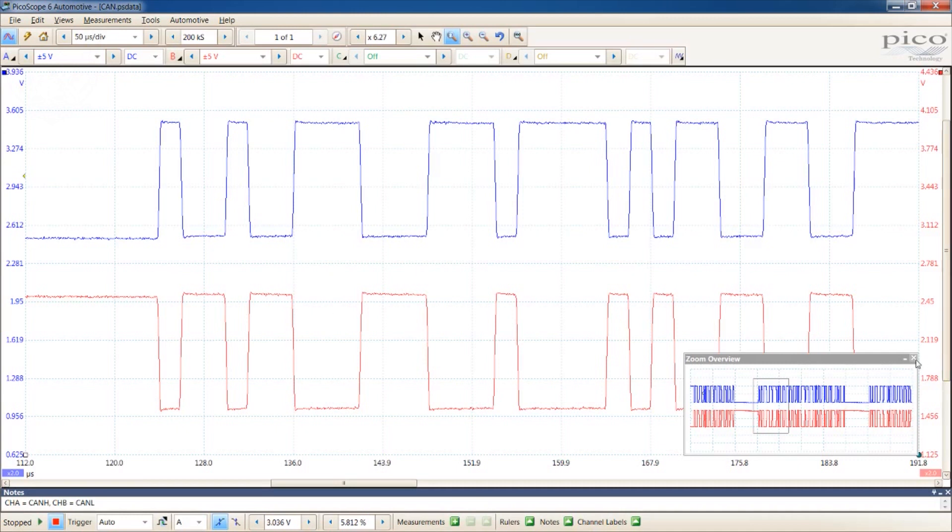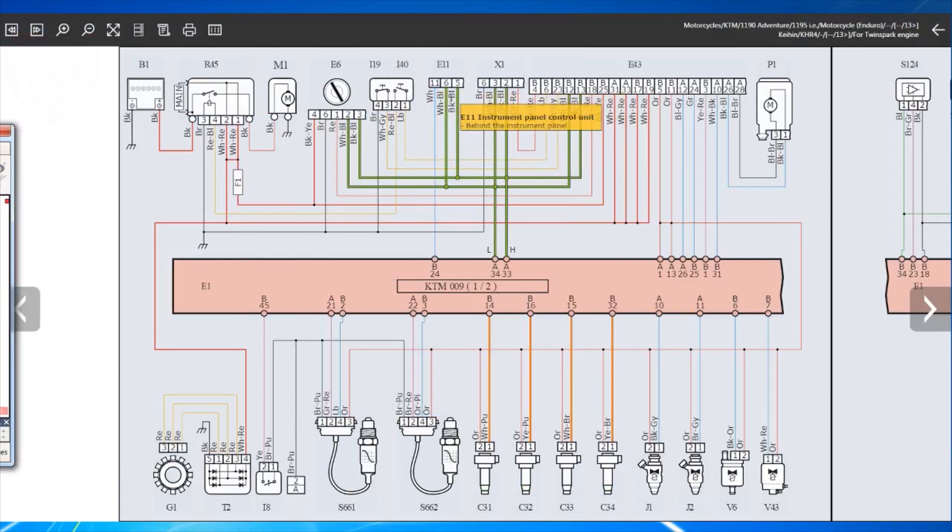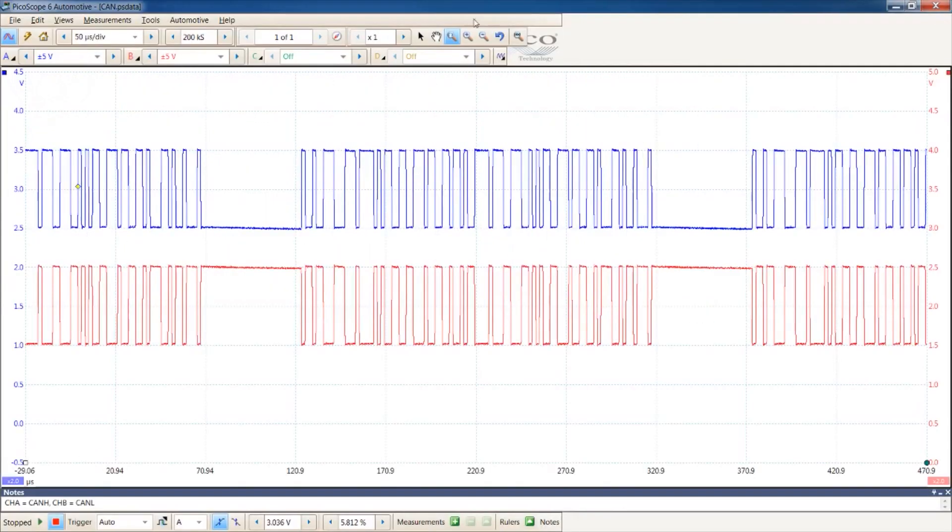Here's the crux of it: when I plugged in the cruise control to the diagnostic socket connector, for some reason I would get a higher amplitude signal which would sort of overwrite all the information on the CAN network - which is why I was getting CAN network fault codes. It would last for about five seconds and then it would find its place in the network and seem to work okay. It was only initially when it was being plugged in. I have absolutely no idea why - I'm just not technical enough to give a real explanation.